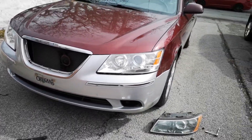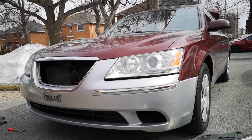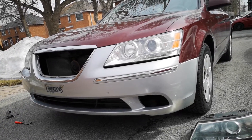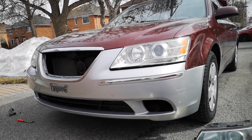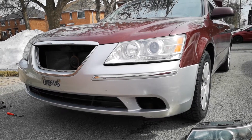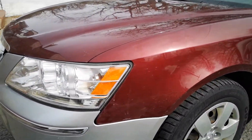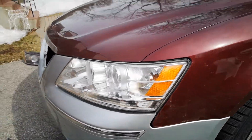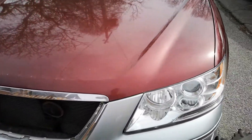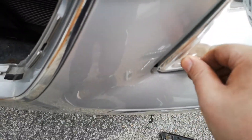Right now there's not a lot of nuts and bolts holding it together. We do have the issue of that big gap under the light, and I'm gonna have to look into that further because this may actually need the core rad support for everything to line up properly. The lights protrude too far out — you can tell there's a lot of overlap right there; they're not seating in far enough.